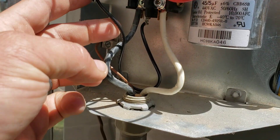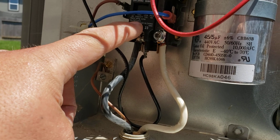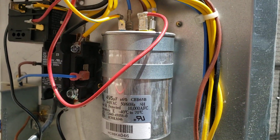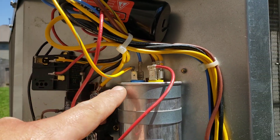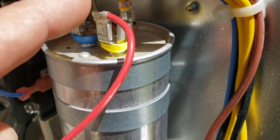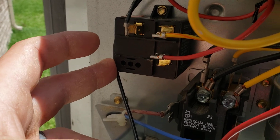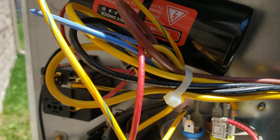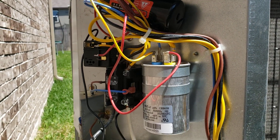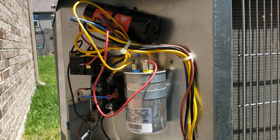You plug your black wire right up under here — it says number 11, it says Herm, refrigerator compressor — and hook it into that. Take your yellow wire from the kit and plug it into where it says Herm on the blue. Take the red and move it right out to the C. This has to be mounted up and down vertical, mounted like that. Tie that on — pretty simple installation, took about 5 to 10 minutes — and now the AC should run with the generator.